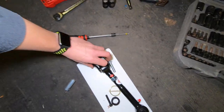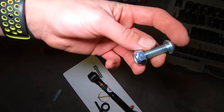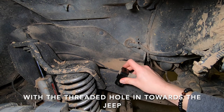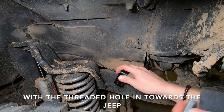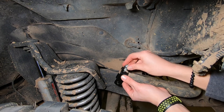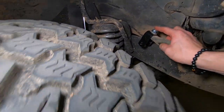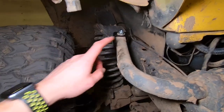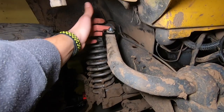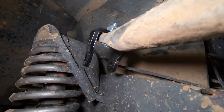It's pretty simple to put together. The first thing we're going to do is throw this bracket onto the sway bar. It takes the nut and bolt that are already connected together. Simply slip your bracket over your sway bar. If you're doing this on a TJ like I am, you don't need the washer — just slip your bolt in underneath and your nylon lock nut from the top. Now we have the bracket installed and you want to tighten this nut to about 40 foot-pounds. Make sure you align it with your sway bar so it's square with the end and doesn't look off or funny.